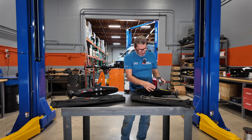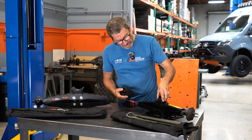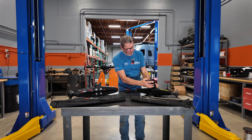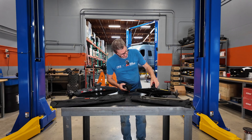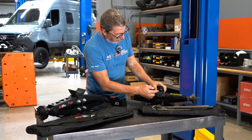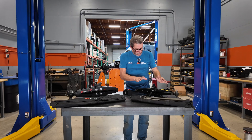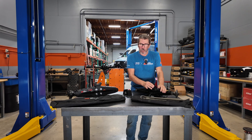There's also a swivel top on the top of the H1. This swivel top is actually designed in there so that when it goes in it can actually pivot and move around. In my experience, I'd prefer to have that stationary. In some cases, what people have done and what I've personally done is take and weld it right along here on both sides. But when you get an H1 scissor jack, it comes to you like this with that pin swiveling.